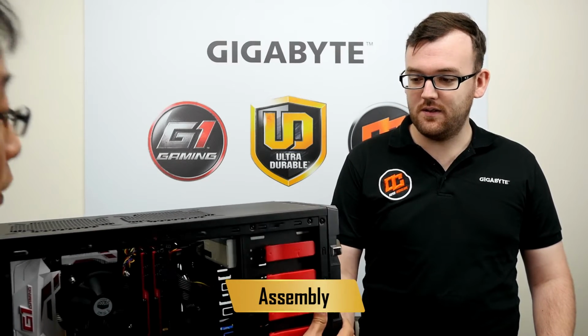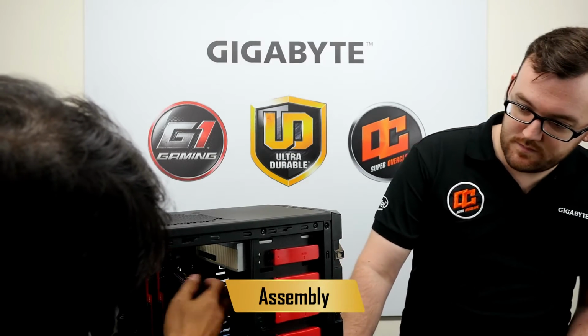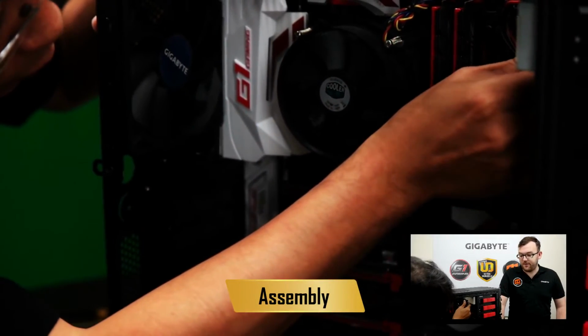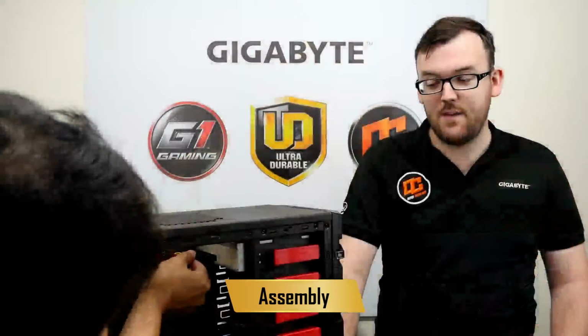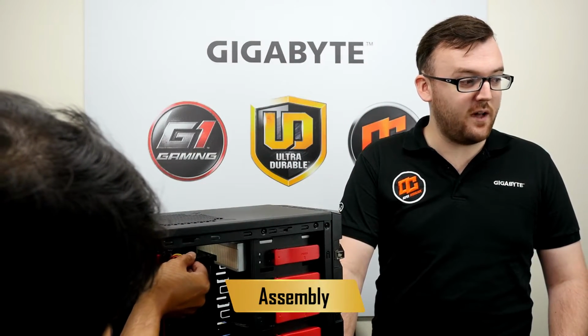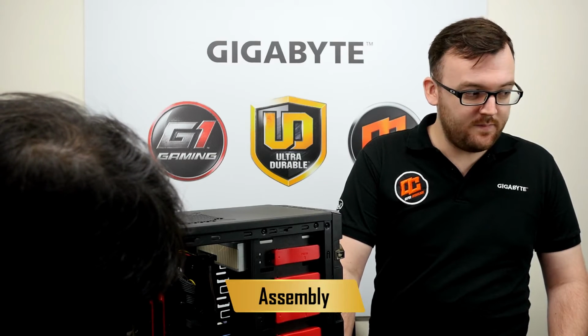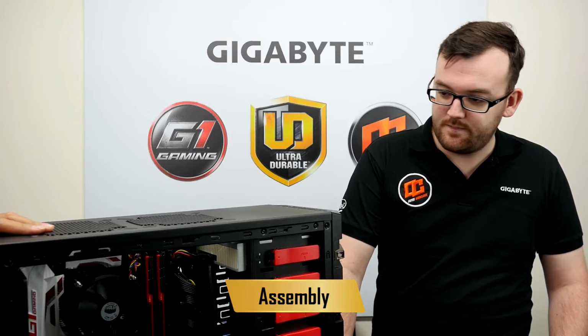Okie dokie, so next step, we will connect the power and the data cable. Just like your hard drive and your SSD, the DVD-ROM drive requires both a cable for power and a cable for data as well. Once that's plugged in to the motherboard, you'll be in business.